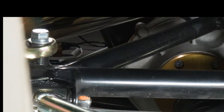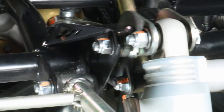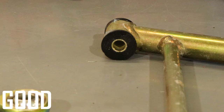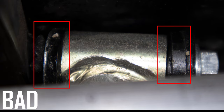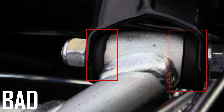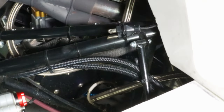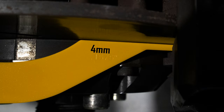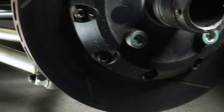Viewing the suspension, check the upright bushings. The tops will be black and the bottoms will be white. If they are separating, damaged, or cracked, notate this in the comments. Check the brake lines to see if any are loose or frayed — if loose, zip tie it back down. Also check the diffuser for any leaks or damage. Check the amount of brake pad with our tool — there should be no less than 4mm of brake pad left. Also make sure there are no loose bolts or objects building up around the rotor or caliper.